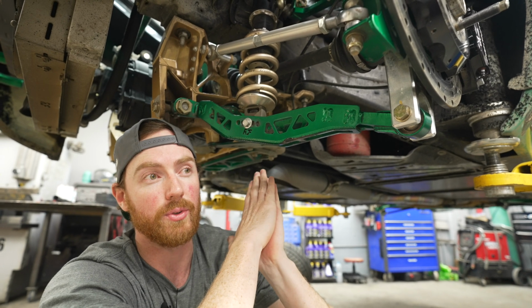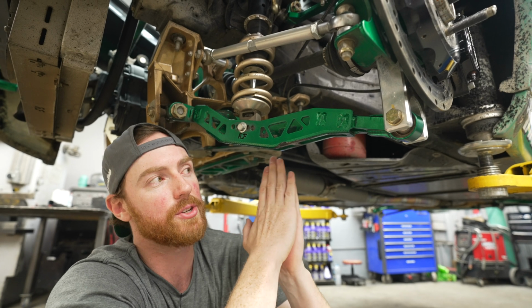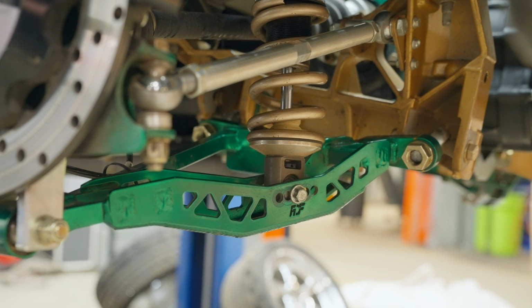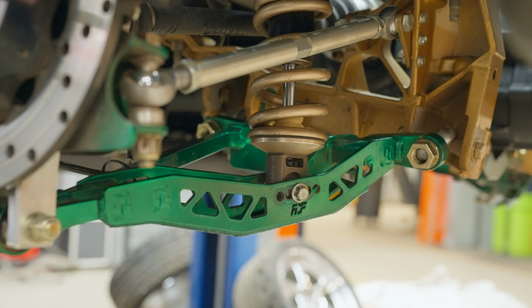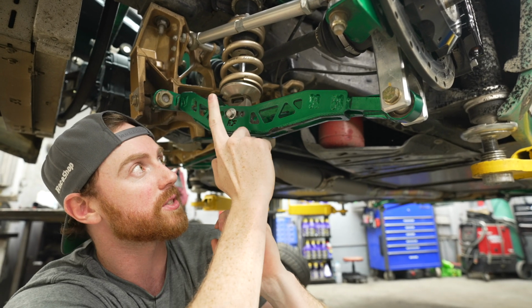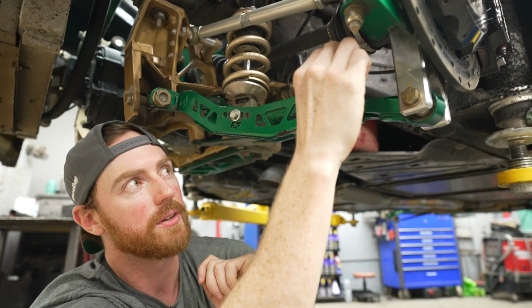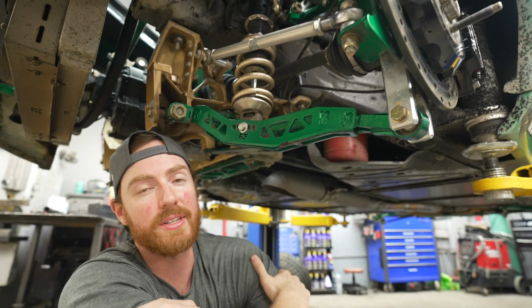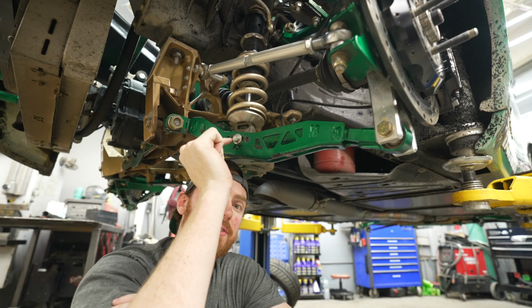That is what you will be dealing with when you buy the kit from our website, unless you email us specifically, but this setup will be very costly and the advantages are pretty minor. So if you buy this kit, you'll be able to run normal coilovers that you have off the shelf. You will still have motion ratio adjustment, but the coilover is going to be mounted closer to this area rather than here. And then the top is going to be the same as factory.